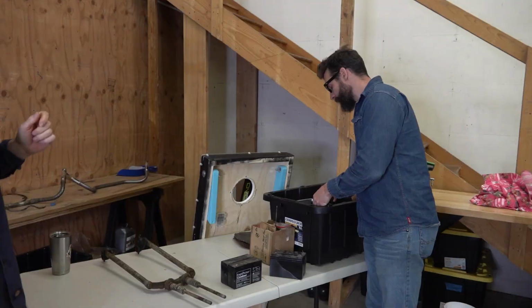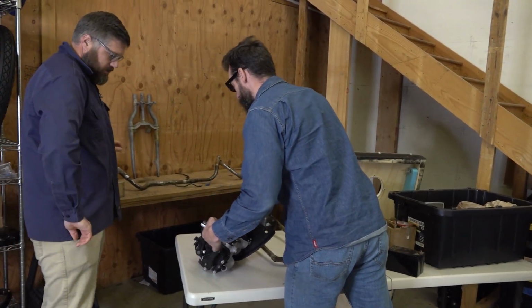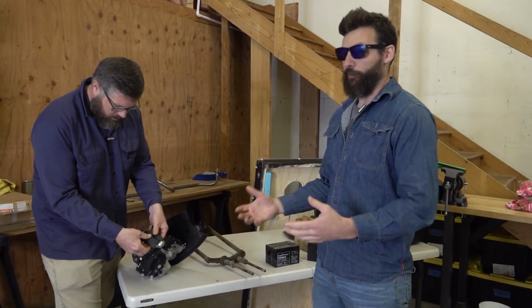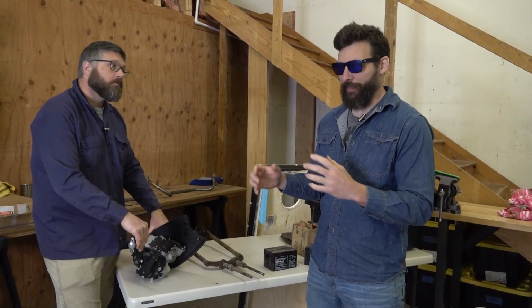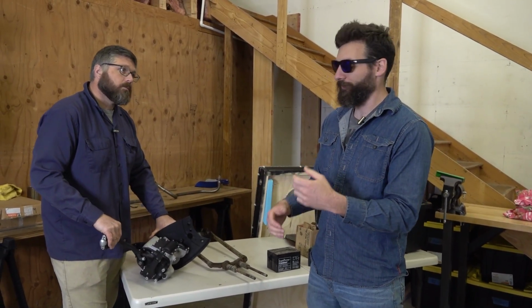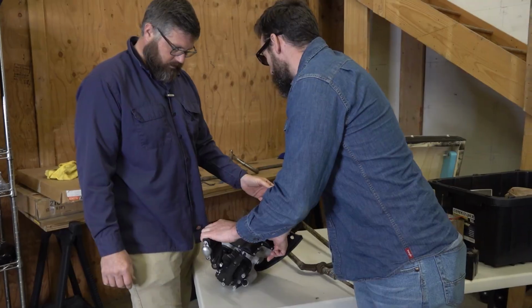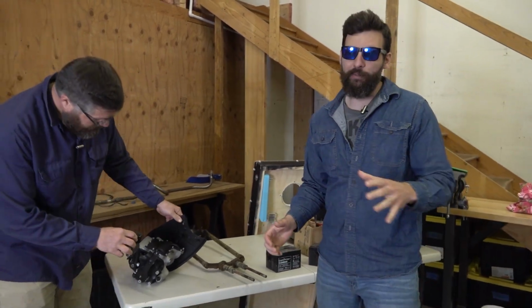Craig, did you actually see the transmission? Not out of the tub, I haven't. Our boy Tim did an awesome job putting the transmission together, and he explained why I had a hard time shifting, because the clutch was all gunked up, and that's why it wasn't actually fully disengaging, so I'm pretty excited to ride it now. And all the detents are good. When you're shifting it, it feels real nice and smooth. Looks great. So I'm pumped about that.